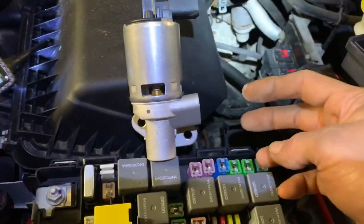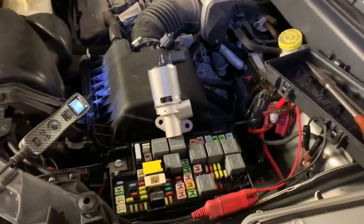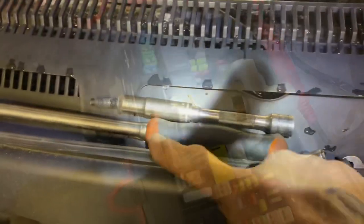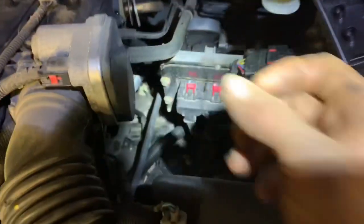It sits in there just like this, so we're going to have two bolts that go in here and two bolts that go in here. They're more than likely 10 millimeters — just guessing right now, but we'll see. These two bolts on the intake are 8 millimeter bolts, and then your two bolts that go into here are 10 millimeter bolts. This is the 10 millimeter extension and socket that I use to remove the lower bolts. You could probably use a combination of everything — you've got a fair amount of room inside there.